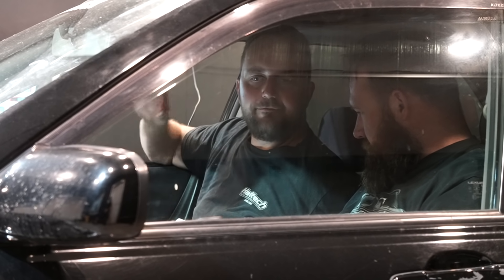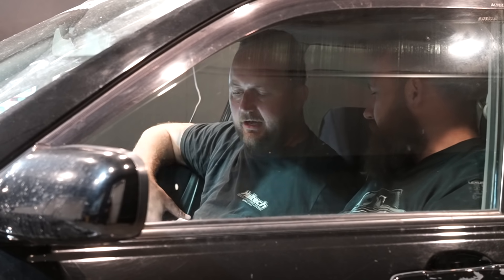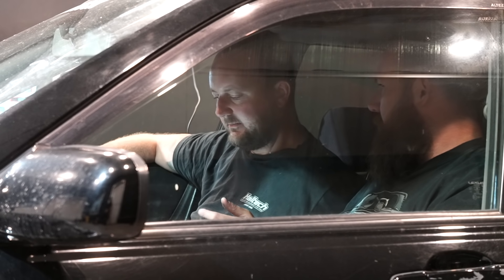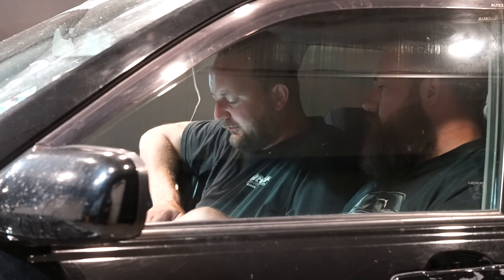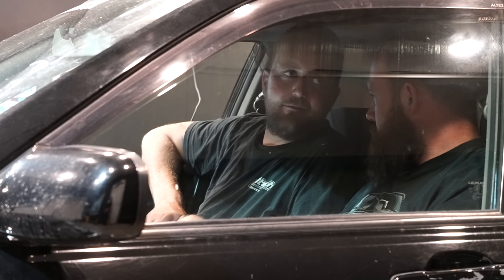The next thing I'm doing — I'm not doing all the light-load stuff yet because I want to do the full-load stuff and get that in the ballpark. If we've got any problems, I don't want to spend all this time on light-load work and then give it a hit and it goes wrong. With the pump change, fuel pressure change, and the injectors, I'll do all the light-load stuff again. You need to rough in the light load before the heavy stuff, but don't spend heaps of time on it because you're going to be going back there anyway. Everything looked all right — just a bit rich everywhere. B-percentage minus 10 — that'll do it.